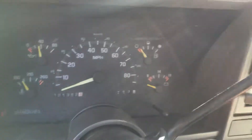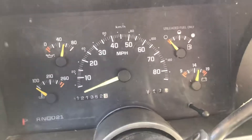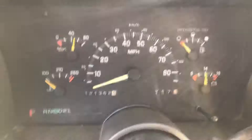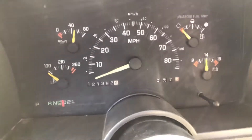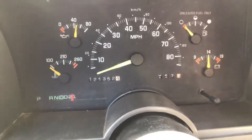Let me start this old girl up. So now when it starts up, it hovers above 14, and when the engine warms up a little bit it'll go to 14. I'm putting a load on it now — turning my heat all the way up, turning my lights on — and it's right at 14. Putting it in reverse, still at 14. Neutral, overdrive, drive, two, one — still holding at 14. When the engine warms up a little bit it will hover around 13, but those grounds fixed my issue.